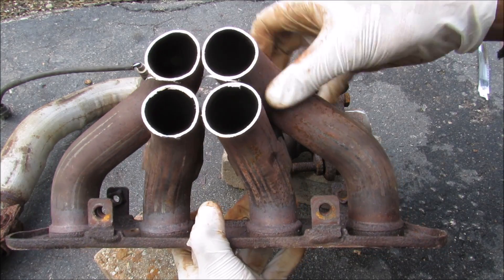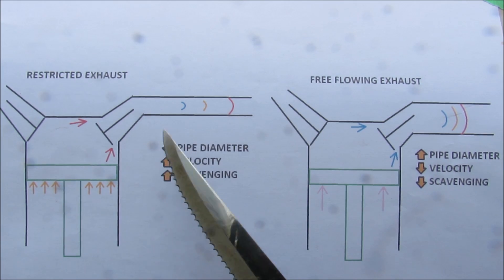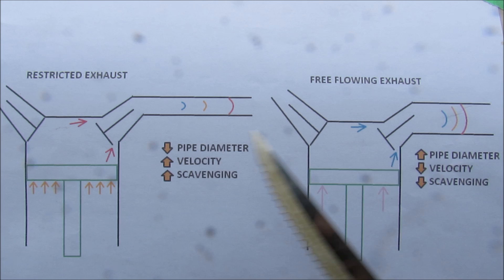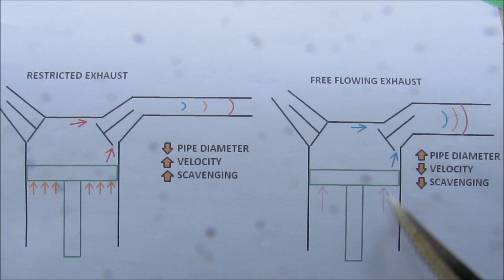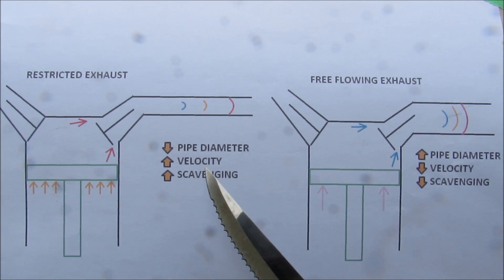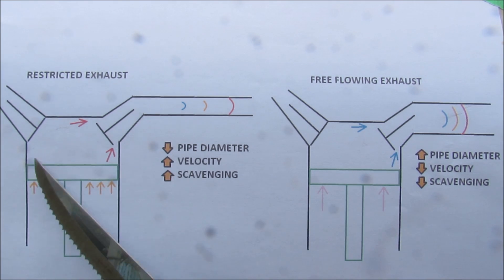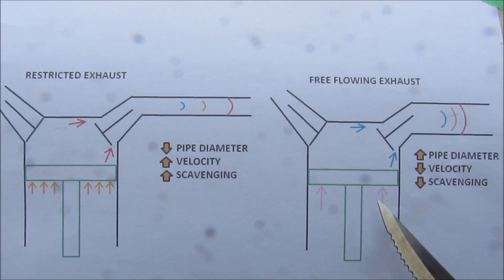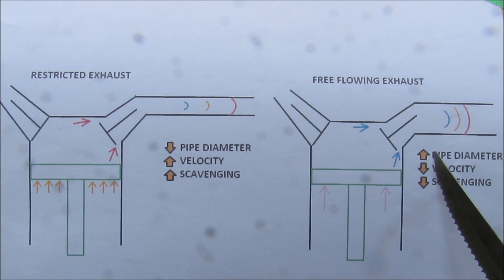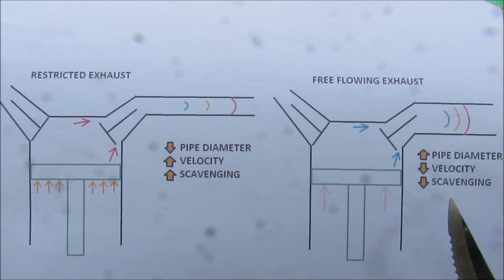The manufacturer has chosen the diameter and length of each pipe to optimize the scavenging effect on the cylinders. Aftermarket exhaust headers will usually go from the skinnier OEM design to a much larger pipe to make it more free-flowing and easier for the piston to push out the air. A free-flowing pipe allows for much easier escape of exhaust gases compared to a narrow pipe where pressure builds up. However, the trade-off is that on a narrower pipe you get a much higher velocity pressure wave, which increases the scavenging effect. With a larger pipe, velocity decreases significantly and so does the scavenging effect. When designing the exhaust header, you need to strike a balance between these two — sufficient scavenging while not exerting too much force on the piston due to back pressure.